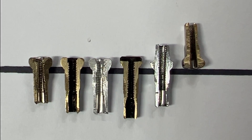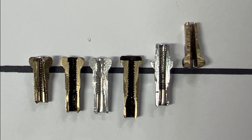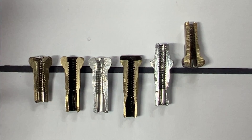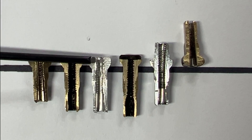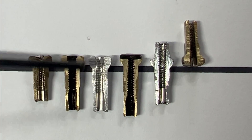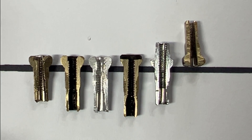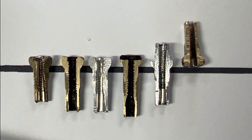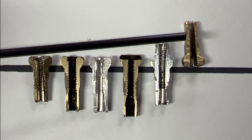Which brings us to a discussion about thread length. As you'll see, 12mm, 14mm and double square nipples threads all start in the same place. On a 16mm Sapim nipple, the threads start a couple of millimetres beforehand, meaning it can be a great way to get you out of a tight spot in an emergency. However, with all nipples — especially aluminium — you need to make sure that your spokes end up being above the shoulder, and preferably fully inside this area, even a little beyond is quite fine. So don't use longer nipples with the expectation of having longer threads as a way to correct for spokes that are too short. You can correct for spokes that are too long using a double square, and an internal nipple means your spokes are going to be much longer.